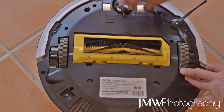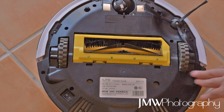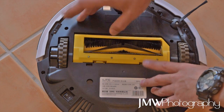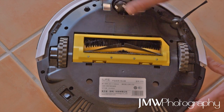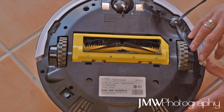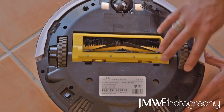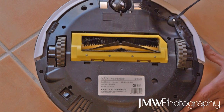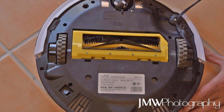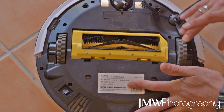This time I took everything apart - all the easy, obvious parts - and was still having the same issue. I took it apart again as mentioned in my original video. Make sure your power's off before doing any of this. I took the battery out from under this cover, and removed all the screws from the edges. These two hold your front sensor on, so you carefully take those off and maneuver your sensor out.